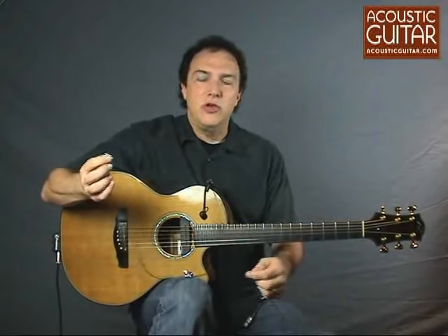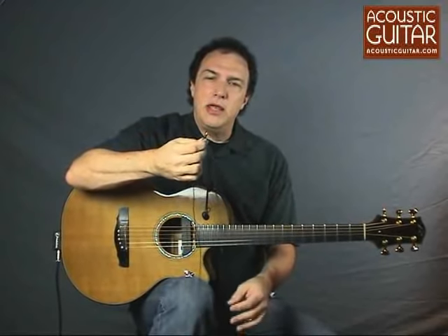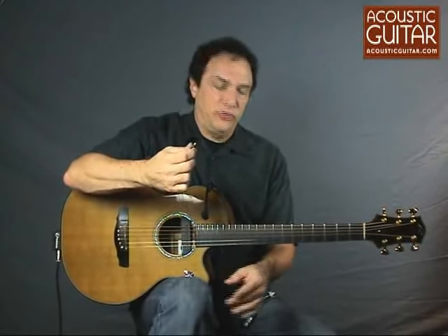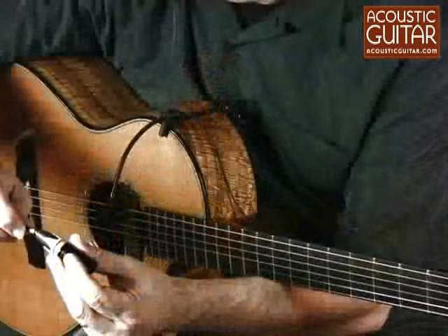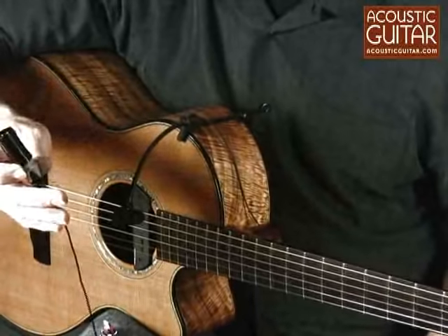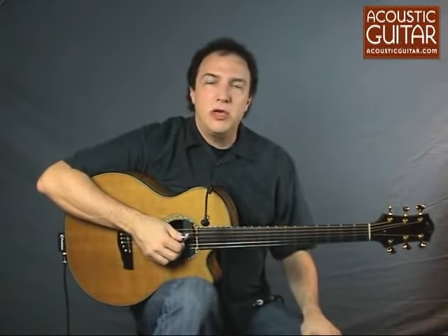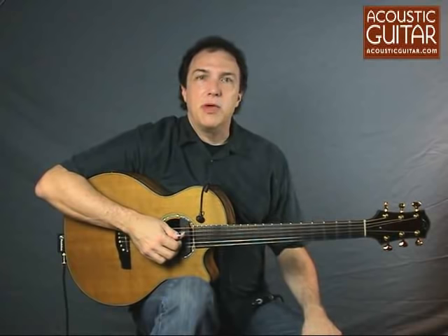Now let's look at how this mic connects to your equipment. There's a six-foot cable, very thin but sturdy, terminating in a micro dot connector. This type of connector is meant for a body pack for a wireless system and expects 5-volt phantom power. But the microphone comes with an XLR adapter — all you do is screw this on, and now you have a standard XLR connector that expects 48-volt phantom power. I'm running this into a Pendulum Audio SPS-1 preamp, which provides a mic channel with 48-volt phantom power. You could run this into any mixer that provides phantom power for microphones — many guitar amps also support that.